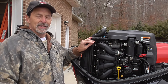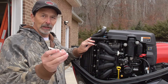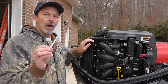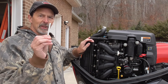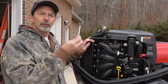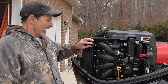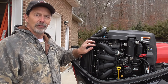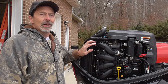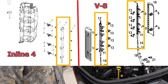One thing you're going to need to know is that I'm going to call this a fuel rail fuel filter, though I don't see it called that online or in the Mercury parts catalog. The reason I'm calling it that is because the difference between this and the inline fuel filter is where this one goes — it's up in the fuel rail. This is the fuel rail on the Pro XS motor, and it's probably pretty much the same on even larger motors. On V8s or V6s you probably have two fuel rails — I confirmed it, you do.